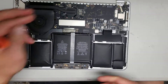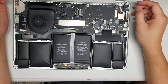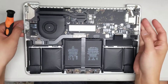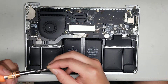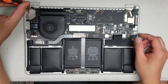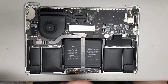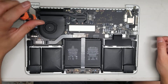Now that the screen is out, flip it back over. We'll go back to removing the rest of the screws with T5. Actually, this one is a Phillips — you'll have to use a PH0 or a J0. Once you remove that, go back to the T5 and remove all these connectors. The fan will have a nut screw right here.